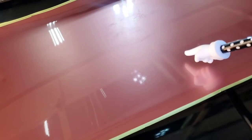So what I'm going to try is that same combination I used up there, the Orange Lake Country pad and the one-step polish. But I'm looking at this, man, that's just rough. That is just rough, rough, rough paint. But I suspect that's going to help, but I don't think it's going to improve it dramatically. It might. Always try the least aggressive method first. So that's what I plan to do.